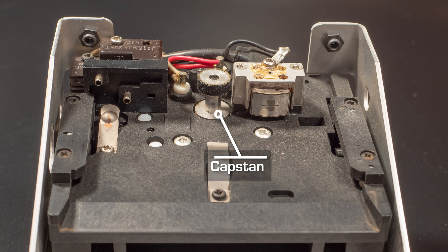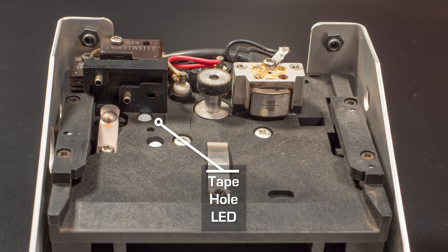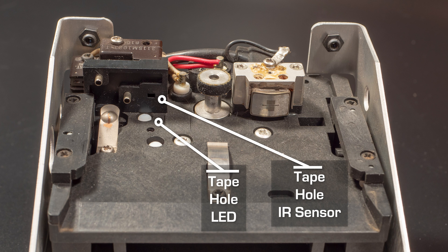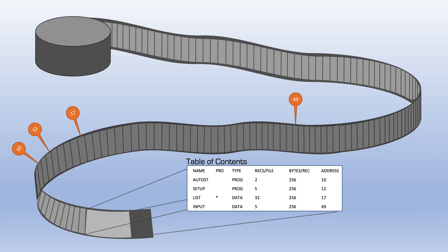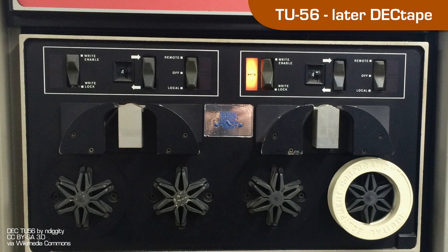The read/write head is here next to the capstan. There are microswitches: one for write-protect sensing and the other to sense whether the tape is present. Those gubbins are photo or IR sensing circuits. The ones at the back are looking for sequences of holes punched through the tape — those indicate tape beginning and end. An infrared light shines up through the base of the tape, hits a mirror, and is sensed by the sensor at the back. There's a second set whose role appears to be to confirm the presence of a tape. The 9845 introduced a dedicated processor for this tape drive called the TACO — that's what's behind those heatsinks. Between the firmware and transport, HP's device is accurate enough to treat the tape as a block-addressable device. You have to format the tapes just like a floppy; once formatted, they can very rapidly shuttle around to find files. DEC popularized this block-addressable tape idea with the DECtape, back in the early 1960s.